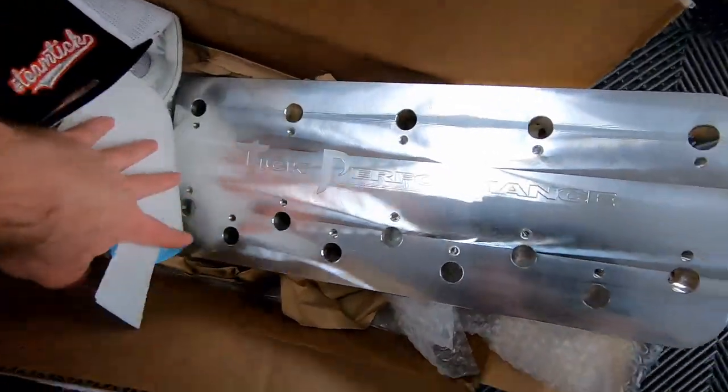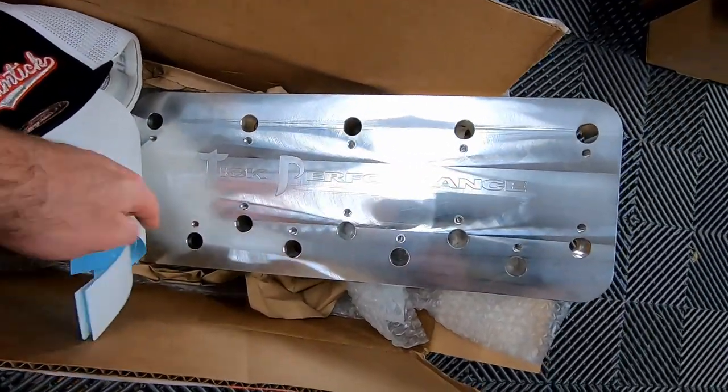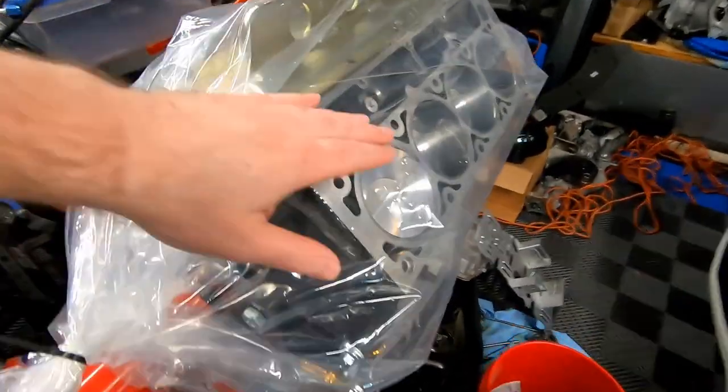And what you guys can see behind us, this is the head stud drilling plate. So what we'll be doing is cleaning up the motor, sealing it up, because we don't want any chips to get inside the motor, and then using that plate to drill out the holes from the stock size to a half inch.